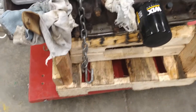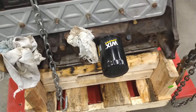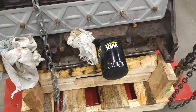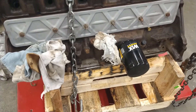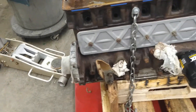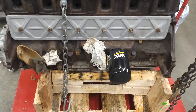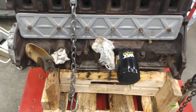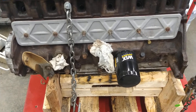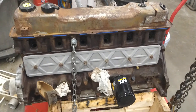Same with the oil pan on this engine — it uses a cork gasket with two rubber pieces. If you take the oil pan off and grind off the nubs, wash the hell out of it, because you really don't want any grinding debris in it. Get it perfectly clean, and you can use the rubber gasket out of a 96. I don't know how far back they made the silicone rubber gaskets, but I think they're a great addition to your engine.